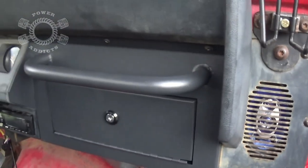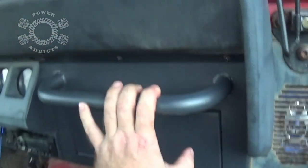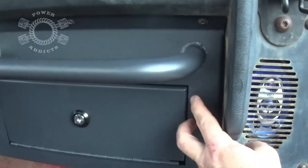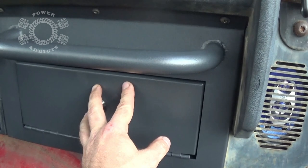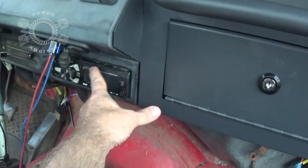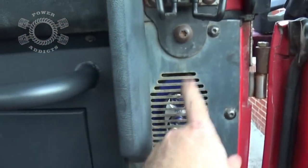Now the passenger side — I had one of the lock boxes in there. What I did was take out all this, including the glove box. You've got three screws up here, two screws here, and two screws here, but they're in behind the dash. I'll include a video where I put this in and use those segments to show you how to take all this out. What I took out was the glove box, and I went through the radio hole to get to these two screws here. These two underneath the dash weren't too bad, and once I got all that out of the way it was easy.